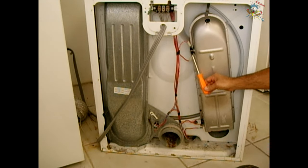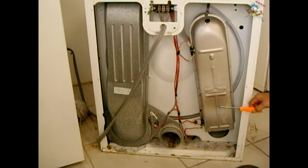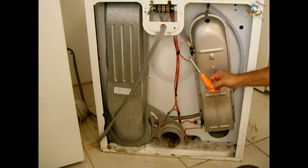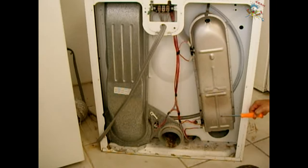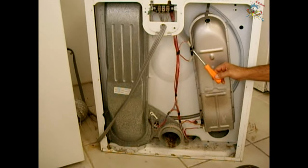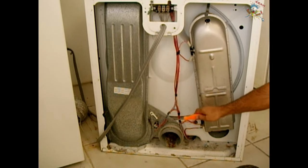In addition, you have a thermal cutoff located right here — this is a safety switch. In the event of a fire or excessive heat, it will trip due to excessive temperatures. This particular one is not resettable; it is one-time use only. If it fails, you throw it out and replace it. Do not bypass it — if you bypass it and the heating element or high-temperature thermostat becomes faulty, you'll have no further protection.